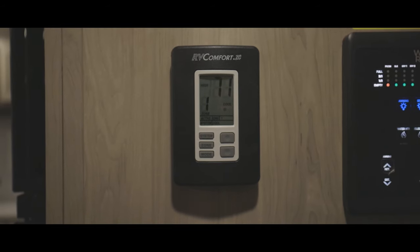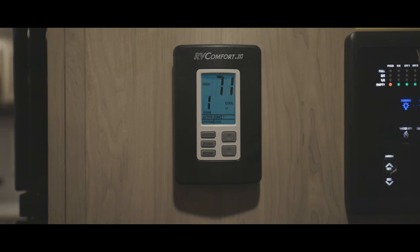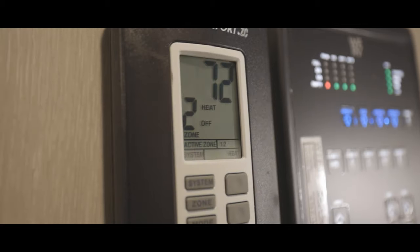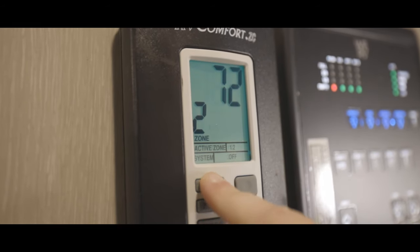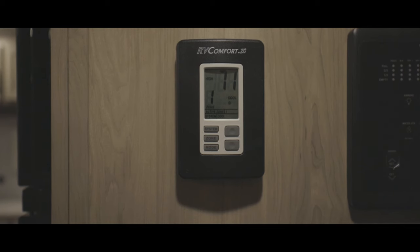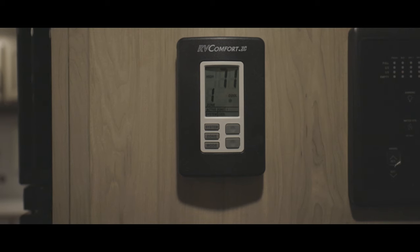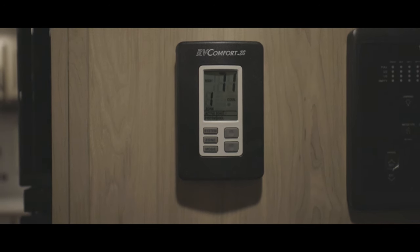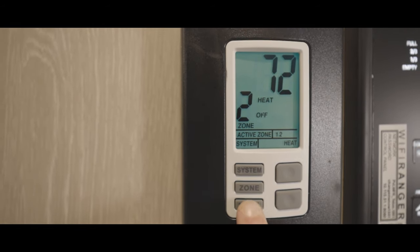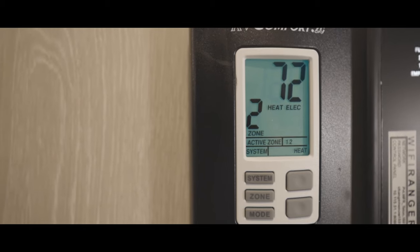The thermostat has two zones for controlling the temperature. Zone one is the main kitchen and living room area of the trailer, with zone two being your bedroom. If your RV has bedroom AC, then you will use zone two controls to work that AC unit. The optional bedroom AC from the factory would include an electric heat strip built into the AC so that you can use that for some additional warmth. To utilize that heat strip, be sure that you are on zone two, then select heat with the source being electric because you're turning on that electric heating element in the AC, not adjusting the gas furnace.